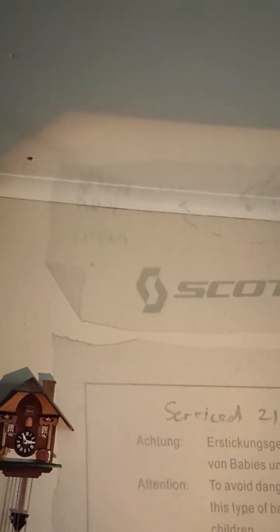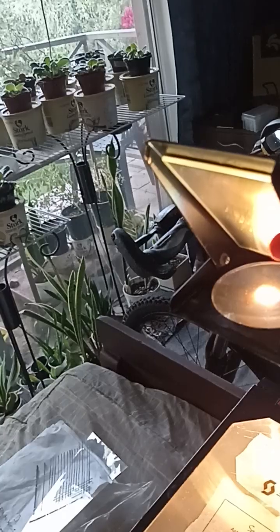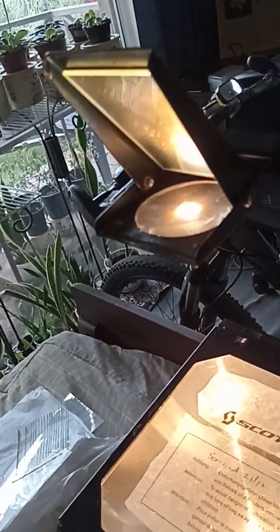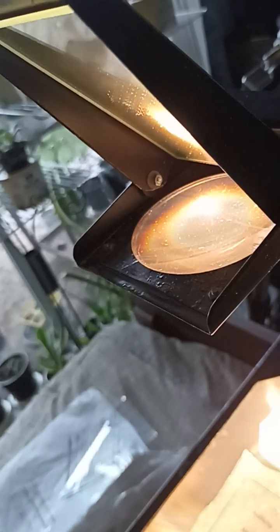Okay, you can see the effect of lowering the lamp housing. Now actually the rays overlap here on the mirror. It's okay like that on the objective lens, but it misses the mirror, and that's actually the orange edging you see there. And the light is also not so bright because it doesn't make use of the total diameter of the objective lens.